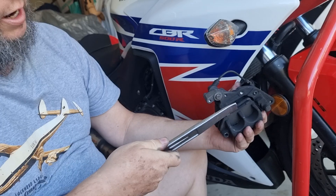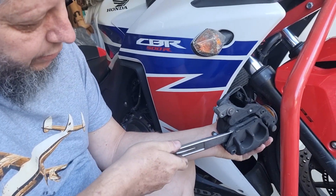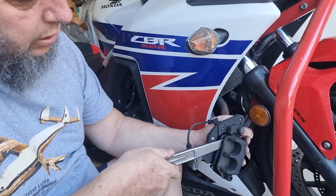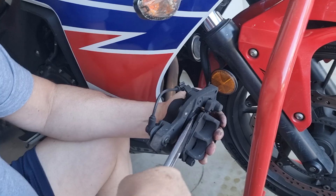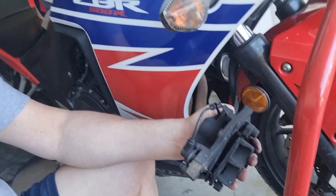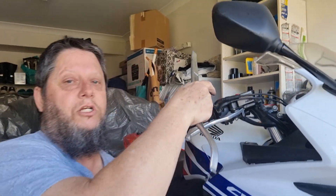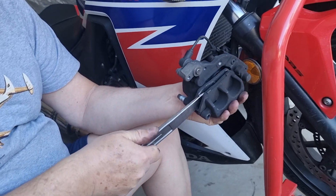I'm using a tire iron, but you can use a screwdriver or a brake caliper separator. You're going to push those pads back into the caliper. While you're doing this, also check here — you do not want this thing to overflow and spill brake fluid all down your paint or anything. So check how much fluid is in there; make sure it's low enough that it won't do that.